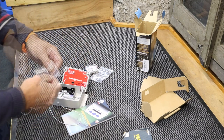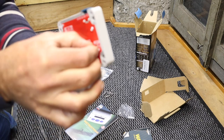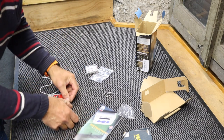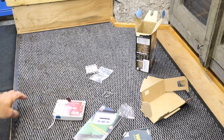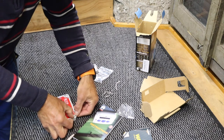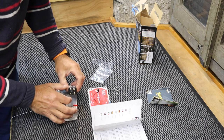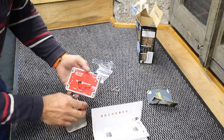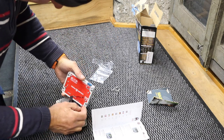I'm going to install the rubber strip now. I'll disconnect the motor just here — that allows the front panel to come off. I'll feed this little strip all the way around like this. There's quite a bit of excess, so I'll trim that off. Squidge it back in, then install the four batteries. I'll sit that inside for now, put the motor connector back on — it is labelled black and red, so black is to the top.